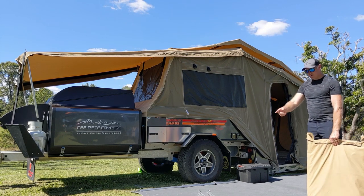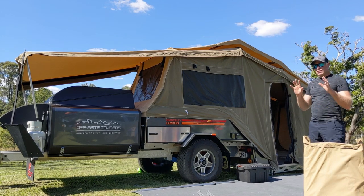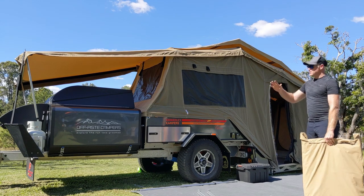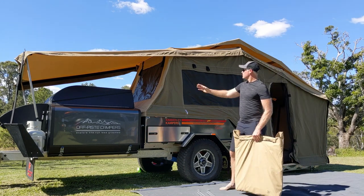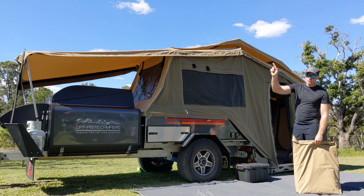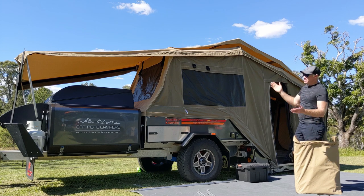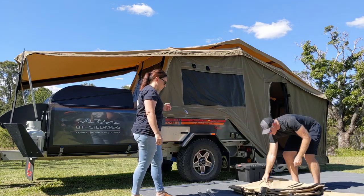The next thing we'll do is connect these two poles. We've got the camera down a little bit lower so hopefully you can see how they work, and we'll add a couple of photographs at the end on how they connect to the trailer and canvas. Once we've got them set up, in each corner of the awning there's a cam buckle. On the awning itself at about that position and above the door there's a strap — we'll connect the strap through to the cam buckle and tighten it, which basically turns each corner into a little triangle section. The whole thing stands up like a big arc.